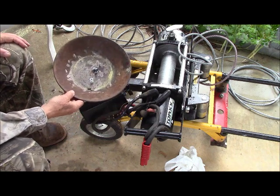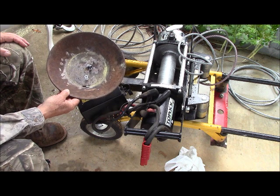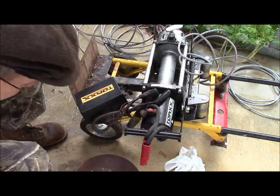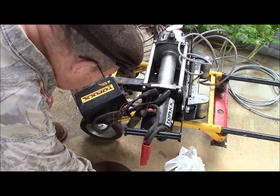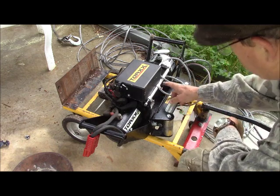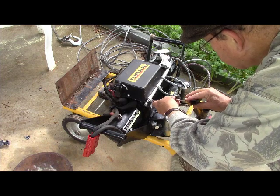Our screw assemblies have been waiting patiently in this gold pan for the final assembly of the control box. And so we have our screw and our washer and our lock washer. And I've already put in one on the other side. And now you can index and start the other two. And now all that remains is to run these screws in right here, and that will reattach the control box to the rest of the winch.